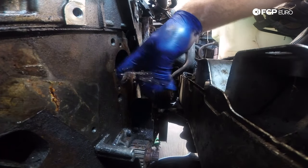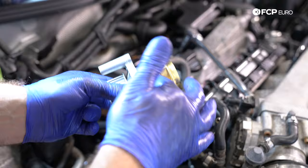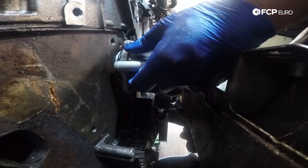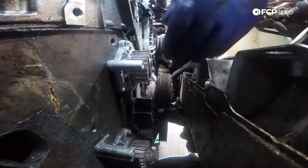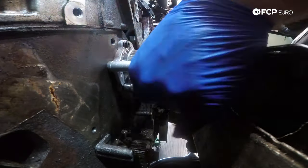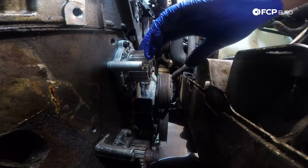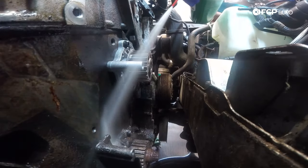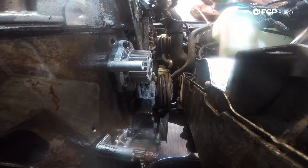Now we have a new pump. We're just going to take a little bit of coolant and rub it on the seal to make it nice and slippery and go ahead and insert that into the block. We're going to install our new water pump bolts and tighten these to 15 Newton meters. Now that the water pump is installed and torqued down, we're just going to take some brake cleaner — you can see how dirty it is — and just clean up the area. Get off any coolant that may be on the crank pulley down there. If you have a wire brush and really want to clean this up, that's a good idea.